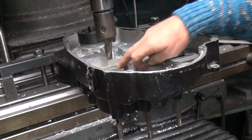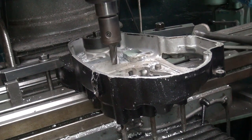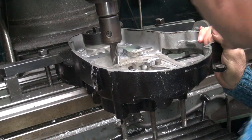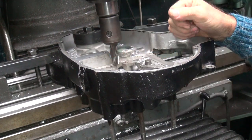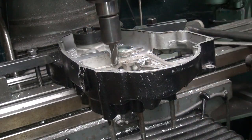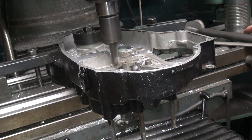I'm going to go ahead and cut this surface right here. We'll skim this surface here. I'm going to cut this whole edge off on this one. Then I have to drop this down a little bit lower. That should be enough. Okay, this is high-speed steel, so we got to turn it slower than carbide. So cut our speed back a little bit. We're at 1200, we'll drop back to probably about 700. There's 720, and a little cutting over here. Okay, let's see what we get.